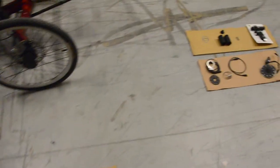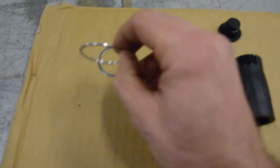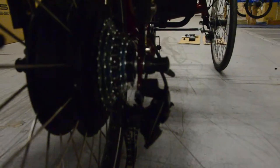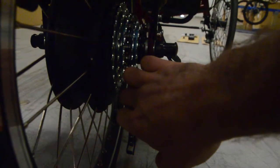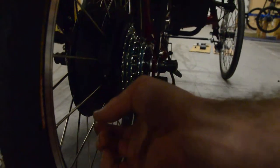The other things you'll do on this bike for the motor: it's usually handy to use two of these thin 9-tenths of a millimeter freewheel shims. We're using a 48-volt rear performance geared kit on this bike, along with an eight-speed freewheel. The derailleur is kind of wide on the inner plates, so to make it fit properly we add those two freewheel shims, and that keeps the derailleur from scraping on the motor while you're running it.